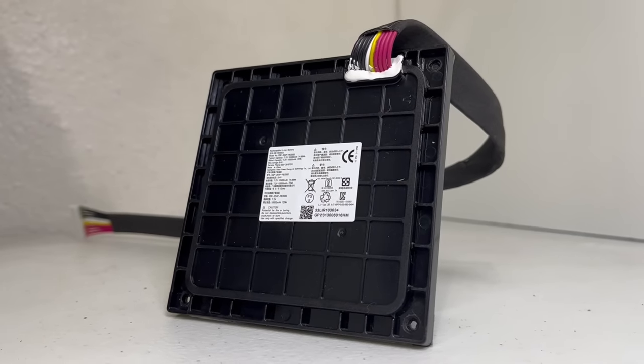Next, we will remove the front panel. The front panel is glued tightly onto the box enclosure so a bit of strength will be needed to pull it off. With the front panel removed, we can take off the LED board by removing 16 screws. Here we have the main LED board with over 60 LED lights and four flash boards with their own individual LED strobe lights. They produce beautiful RGB lights that can be controlled from the speaker or from the JBL PartyBox app.